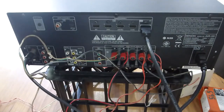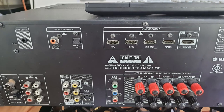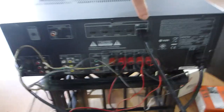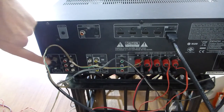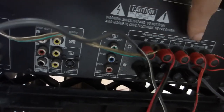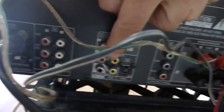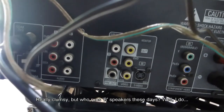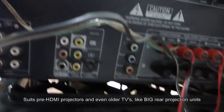That's the front, and that's the back panel. You get 1, 2, 3, 4 HDMI inputs and 1 HDMI out. These are HDMI 1.4A, supporting 3D and audio pass-through, plus ARC — audio return channel. You've also got a TOS-link optical, a coax, and 1, 2, 3 analog RCAs. Speaker binding posts cover front, center and surrounds — no B speaker posts, but you can use pre-outs for a second amplifier. You've also got assignable component RGB and 1, 2, 3 composite.